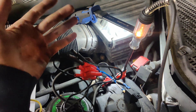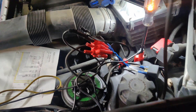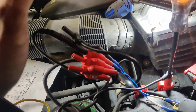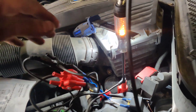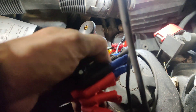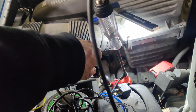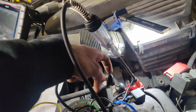So I found out an issue - I tried doing just a light bulb and you need more current. I just fought with this thing for 15 minutes trying to simplify it, and tried doing just a test light. It'll just flicker the light on one time at key-on and that's it. After that it won't turn back on again, you can clear codes and it won't do it again - it does a quick test and that's it. See how it just went out - it can't do the test light. I think it sees it as not pulling enough current, so it won't turn this light on anymore.